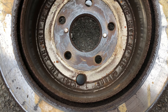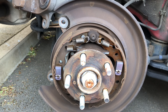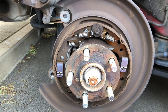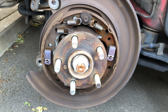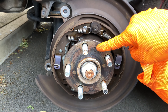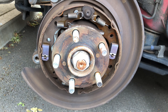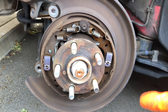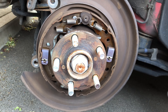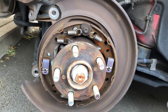The old disc drum is now removed. Interestingly it was made by Subaru, which surprised me because this is an NBK brake system. I'm going to use brake cleaner to clean off the surface of the shoes and a wire brush to clean the corrosion off the hub face. Without doing this the contact points between the hub face and the new disc won't be uniform, which can cause disc warp when the disc gets hot.